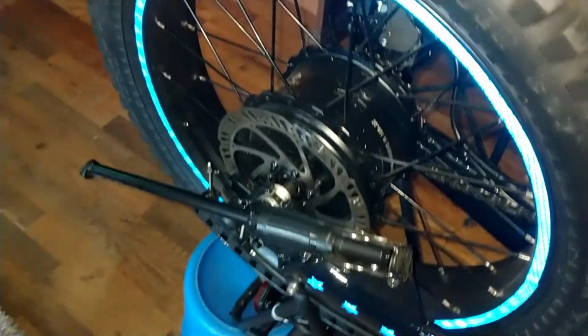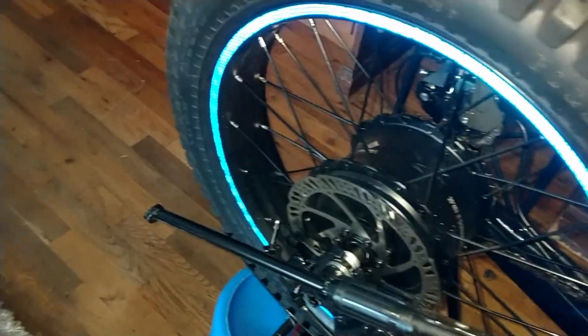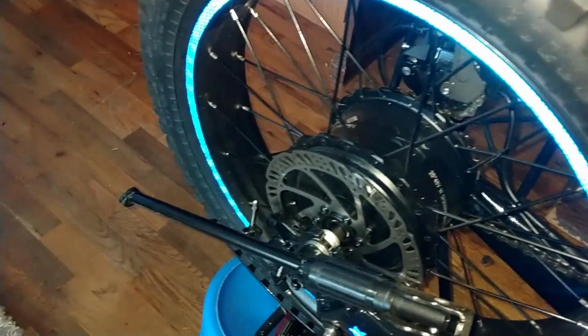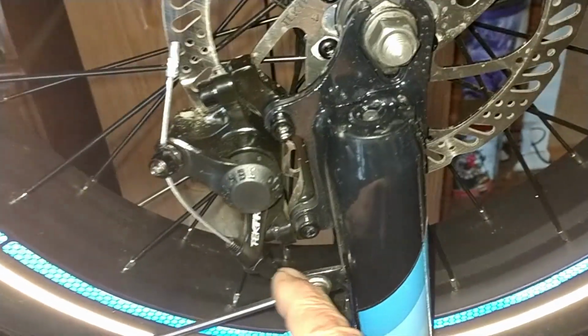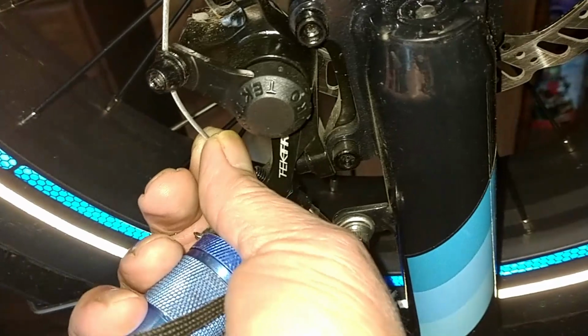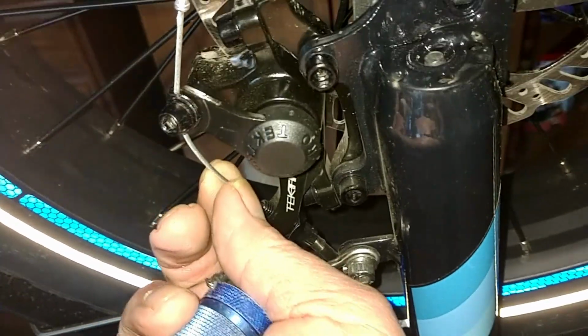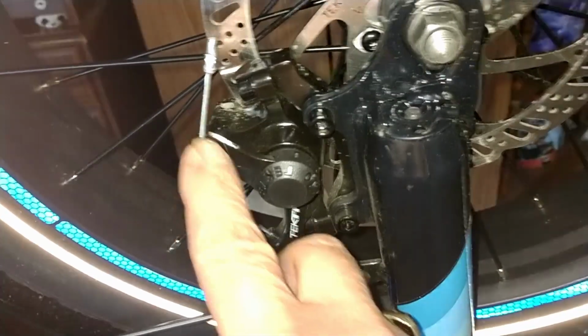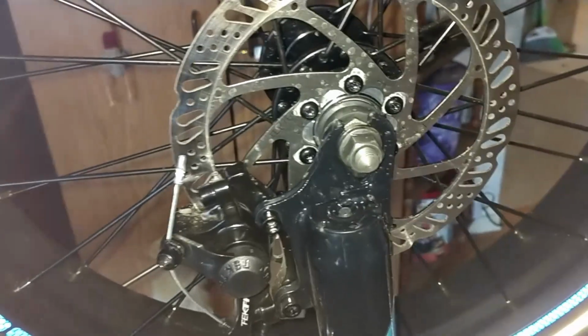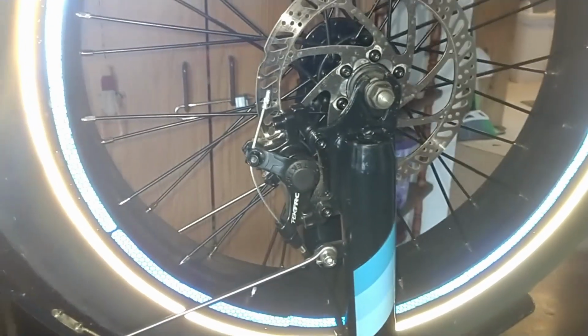Honestly, I think the most I'm having to do with the bike, maybe every couple of weeks, is tweak the brakes, do some brake adjustments. If you are doing any brake adjustments, guys, like taking the slack up in your cables, make sure that you are turning your barrel adjusters all the way back in so you can take up the full amount of slack in that brake cable, all right? And do not over tighten these down.